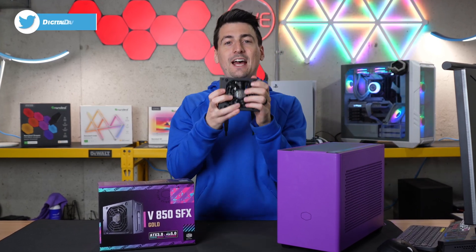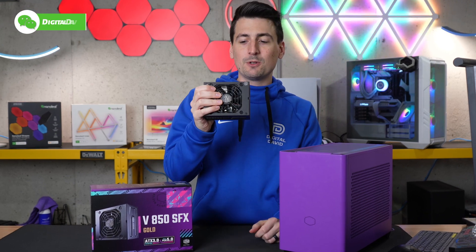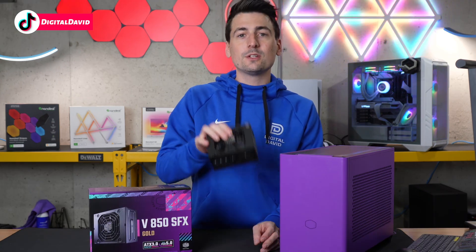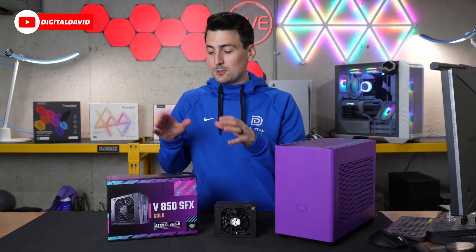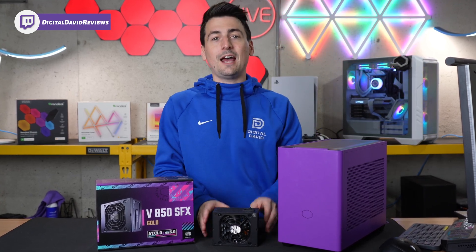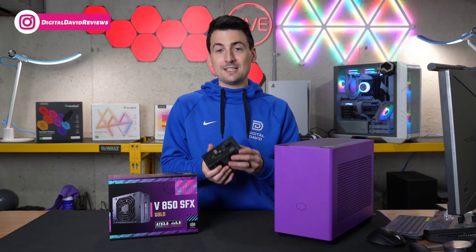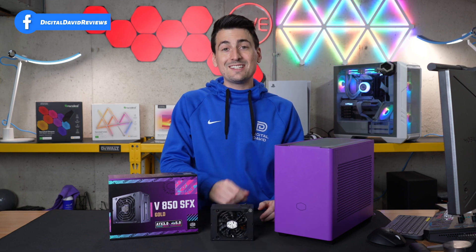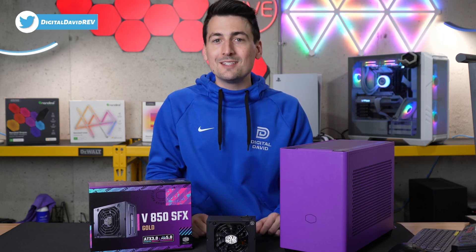So here are my final thoughts after using this power supply. It's small yet mighty — that's what you need to know. Great for tiny builds, and you can get really creative. Yes, you can use it in larger builds too, but cable length is going to be an issue. It's nice that we have up to 450 watts supported with a single cable for the GPU, so if you're looking to add some of the latest GPUs, look no further. I expect it to hold up great for years to come, and you can buy with confidence given the 10 year warranty. By that time, you'll probably have already upgraded your PC again.